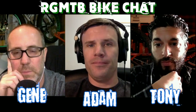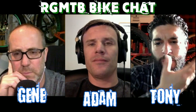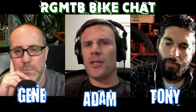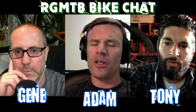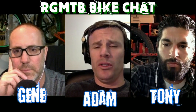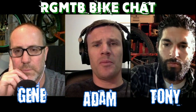Gene confirms you can use regular tubeless sealant like Stan's with CushCore — no tubes needed. Adam says they've had good luck with Stan's, Effetto Mariposa, and they're testing a new one called Plasma from E13. CushCore is a closed-cell foam so it's not affected by sealants and doesn't absorb sealant at all — unlike one competing product which uses open-cell foam, which is the wrong choice for this application. Their special shape is made in a giant custom heated aluminum mold, which allows them to shape it however they want, though it's more expensive to manufacture that way.